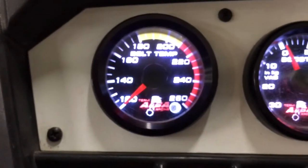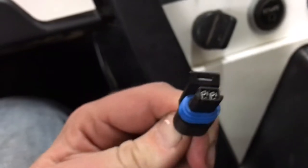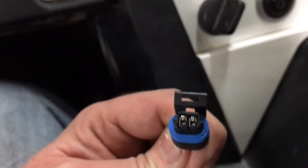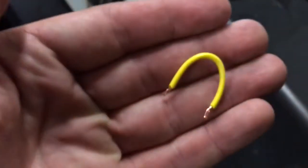We're in a Can-Am Maverick here, so the belt is right in between our legs — pretty easy to get to. I've got our sensor wire in front of us. It's a jacketed weather pack connector that's got two connections inside. These two connections are what we're going to jumper together to program the gauge. What's needed is a small piece of wire — you can take the excess yellow wire that comes on the fan, strip both sides, and use it as a jumper.